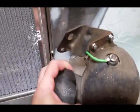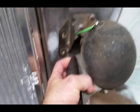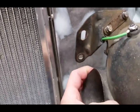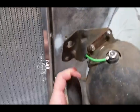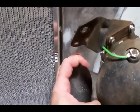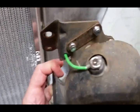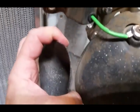I've done a wire on here — just a little piece of wire with a spade on the end for mock-up — and that'll bolt on there. Originally they go up a little higher and the wire coming off the horn is pretty noticeable going up to the main harness. I'm trying to hide as much wiring as I can to make it look a lot cleaner. So I drilled a hole in there and put a little rubber grommet for the wire to go through — that's all the wire that'll be exposed. I'll probably do some kind of black shielding on it to make it disappear some more.